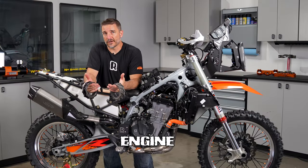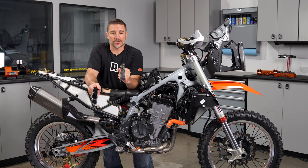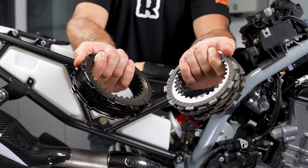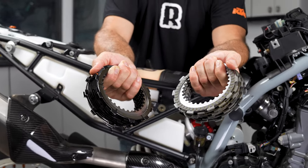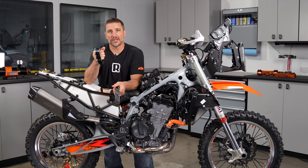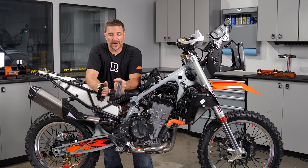We covered the outside of the engine with fuel and air. Now let's talk about what we do on the inside — and truth be told, it's not as much as you might think. There are two things we do inside the engine. First, we replace the weak stock clutch pack with a Recluse torque drive — a no-brainer and a great piece of insurance. There's about 38% more friction surface area on these discs because they pack 11 discs in here versus the stock 8. We've run these in the Sonora Rally, checked them every other day, and they ran perfectly. Second, we run a Factory Pro shift kit, which has a stronger spring and an actual roller bearing — it helps the shifting and cuts down on false neutrals. Outside of that, we really don't mess with much else inside the engine. We are working on some cams as of the filming of this video, but haven't released those yet.